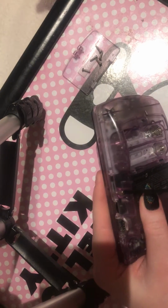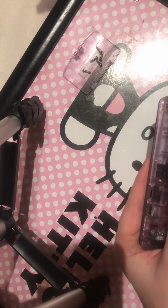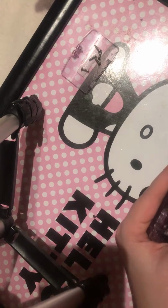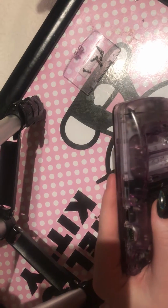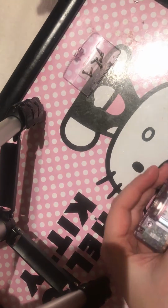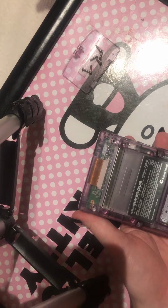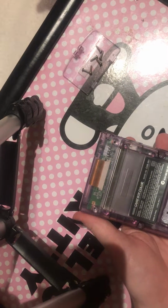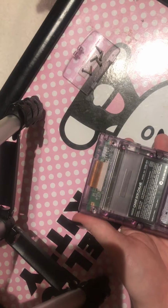The closer to 100% is just better because it's closest to, obviously, the alcohol rating, which also means that it will clean better. It also basically doesn't corrode the pins, and obviously you use it with Q-tips and wipe it off. You don't want to leave any kind of watery substance on there, but it is the best one to actually use, to be honest.